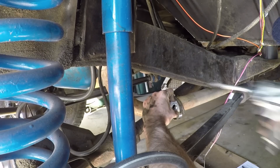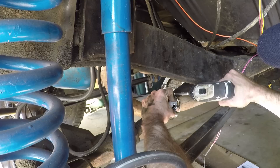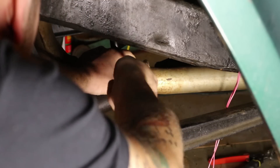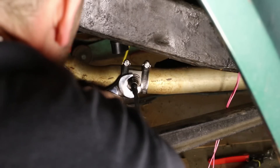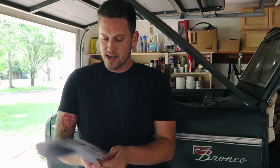Then clamp the sensor on. My exhaust was smaller than the clamps Phytek provided, so I had to buy smaller clamps. When clamping, take your time and go back and forth — don't clamp down one side completely because that will leave the other side open for possible air leaks. Then remove your carburetor, throttle linkage, fuel lines, and vacuum lines, and figure out what vacuum ports you're going to need.